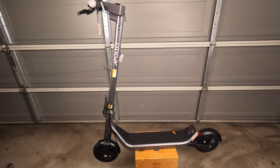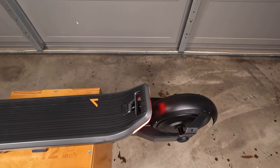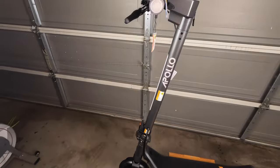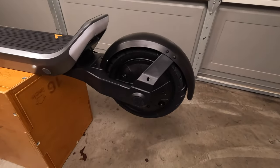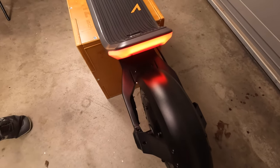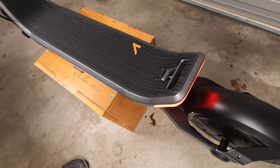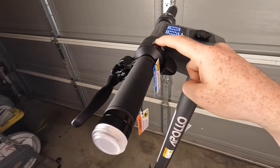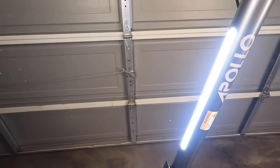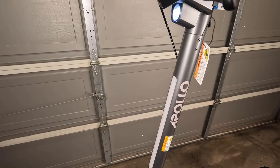The scooter is back on the block — let's test the motor function with kick-to-start off. Rear motor works, front motor works. Testing the turn signals — front and rear turn signals on both sides work. There's the taillight glowing red, and when you hit the brakes it blinks, which is really nice for visibility. To control the headlight: single press the M button to turn it on, double click M for the ambient light, double click again to turn ambient off, single press M to turn off the headlight.